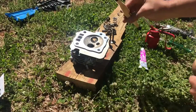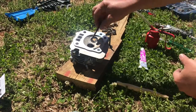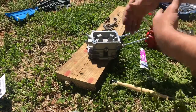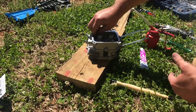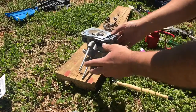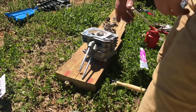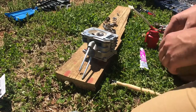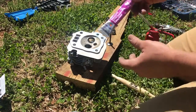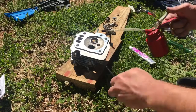I'm going to use the suction cup and dowel method. I have used a hose before — you stick the valve in and work it back and forth — but that method is tough because you can't really see what's going on. I've seen people use drills as well, but with a drill it's easy to take a little too much off very quickly. So we're just going to use the good old suction cup and some valve grinding compound from the auto parts store.